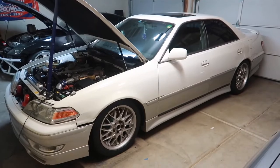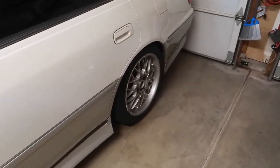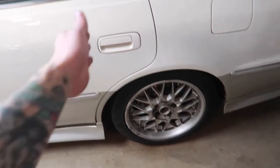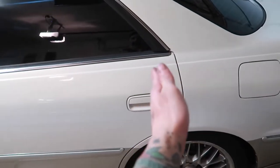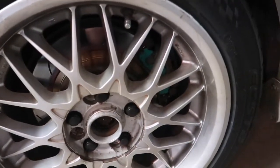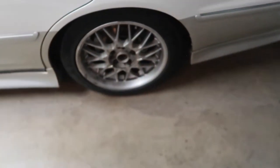We are back from our final maiden voyage, and the Mark II's braking system is top notch. We fixed the issue as you saw in the previous clip. When the piston pushes on the pad, the guide pins are supposed to move simultaneously, but how this was moving was at an angle when you would compress the brake pedal. So we got that uneven wear, but good thing we caught that in time, or the rotor could have warped and the pads could have deformed. So a huge shout out to Warren.